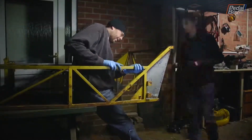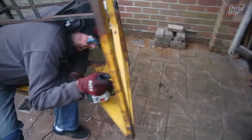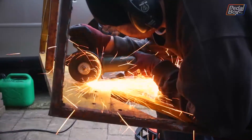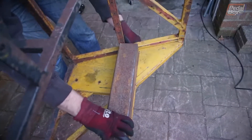You can see a whole bunch of markings that we took on the end plate here. They're not really relevant to what we're doing today, but since we're building a CAD model of the car, they're going to be useful later. Once again, we're cutting bits off the car. What we're doing here is marking up and cutting out a section of the side panel to insert the chassis legs into later. We could in theory have left it in place, but having to cut the chassis leg to fold around would have just been a nightmare.